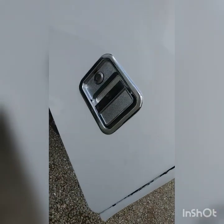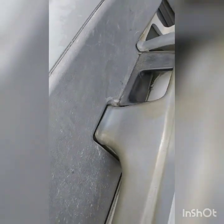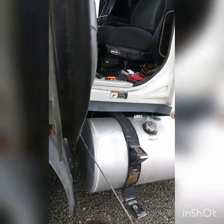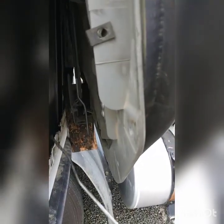It looks a lot better — brand new. We gotta connect these rods. This one down here is the one that comes up from the door handle, from the top of the door handle. That one came off completely — just fell off — so I'm gonna put that one in first. Then this one, of course you can tell which way it's gonna go — it's gotta go in the hole up here. Once you get it through there, then you can connect it down here.